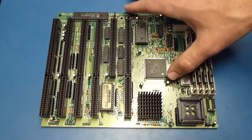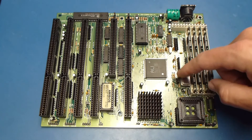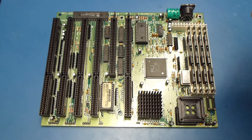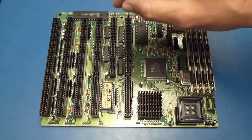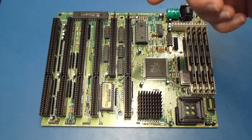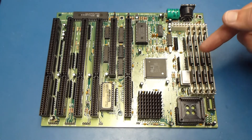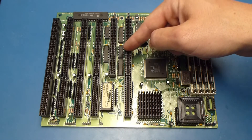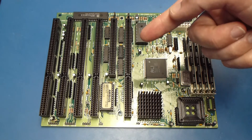The AT clock is determined by two jumpers here, and how you set them up just depends on how much it divides the bus clock. What I've done is changed it to the lowest divider it'll do. So in these benchmarks, I've got a 50MHz overclock on a 33MHz processor, zero wait states on my 60 nanosecond SIMMs, and my ISA bus is running at 20MHz versus the original 8.3.